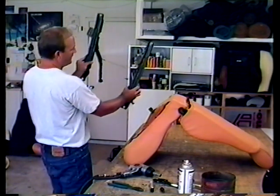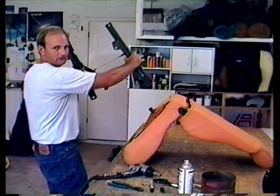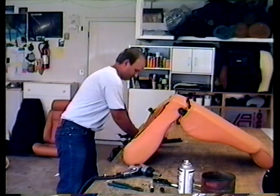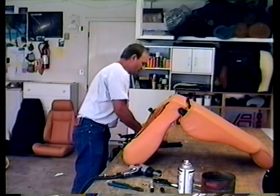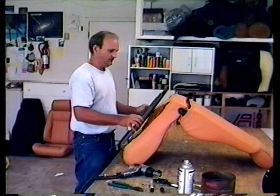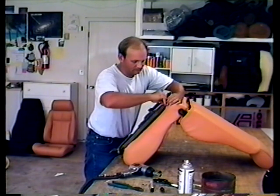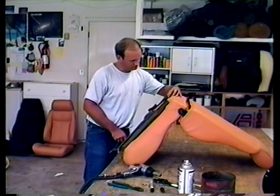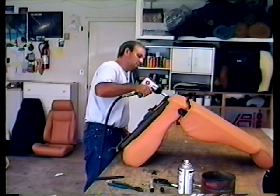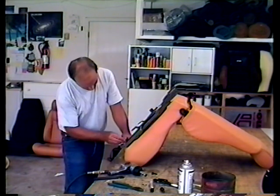There was a wire that connects the two locking mechanisms — don't take it apart, just leave it and put it right back on. See the little chalk arrows? That's front. Put the back ones on first because they have holes — the ones at the front have slots, which allows for manufacturing differences. If you try to put the front ones in first, you'll have a real hard time getting the back ones in. Tighten those down, then put the front ones in.